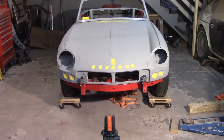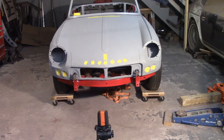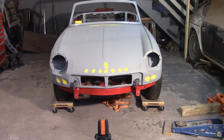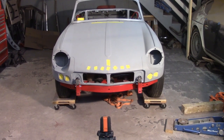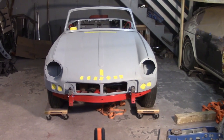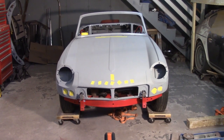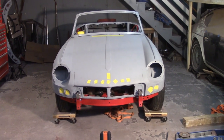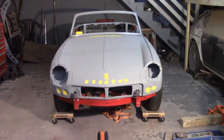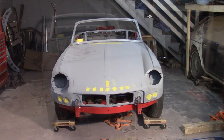What I'm going to do now is get the car on jack stands so I can remove the suspension from the equation. I'll jack it up, get jack stands under it, try to level it out, and then look at the body lines to see if the body is maybe crooked. Hopefully that will help me figure out whether gap issues are being created because the body is not on straight. This may be a shim issue - I'm kind of stabbing in the dark here, but I've got no hurry.